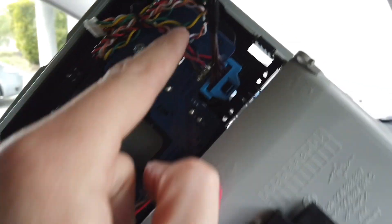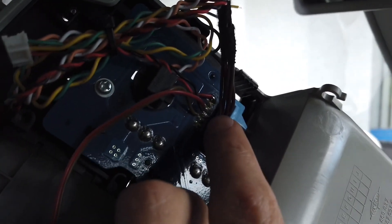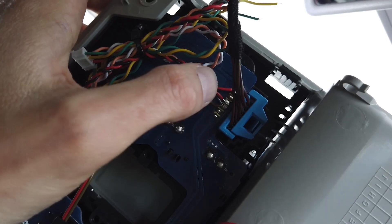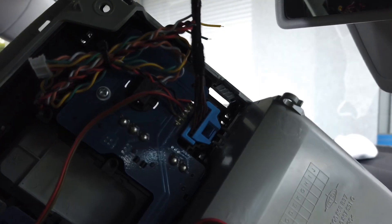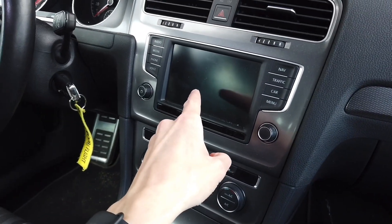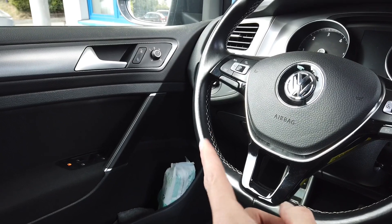I've soldered over here — there's a 6 pin connector and those pins are right here. I've used pin number 3 and pin number 4. The fourth one is ground connection and the third one is the dashboard dimming signal. This is the signal that lights up your dashboard, your instruments, and you can adjust this brightness from your infotainment screen, or in a US spec car I believe there's a dimmer wheel next to the rotary light switch.